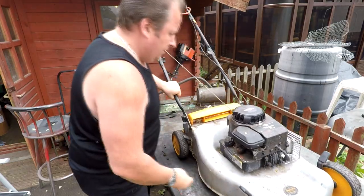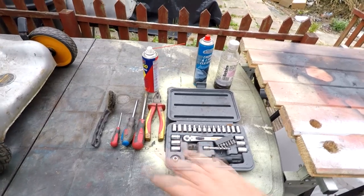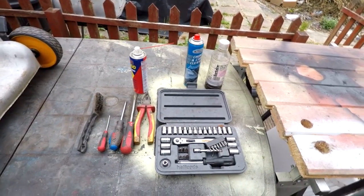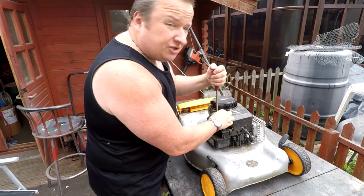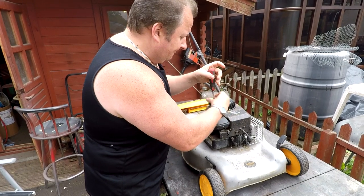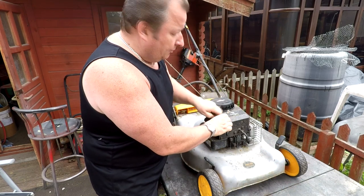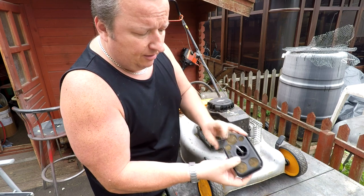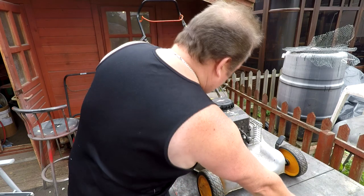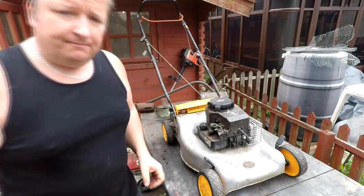There we go. As you've probably seen in my other videos, I've got the same toolkit out, and we're going to repair this lawnmower. The first thing I'm going to do is take the air filter off. We don't know whether it's been tipped the wrong way. It's obviously a running issue, so we know we're getting spark. We're not going to investigate the plug - look at that, it's nice and dry and clean, so we know that's okay.